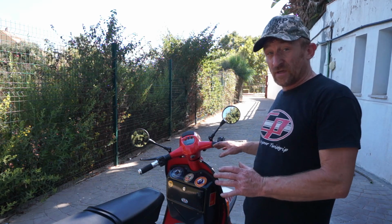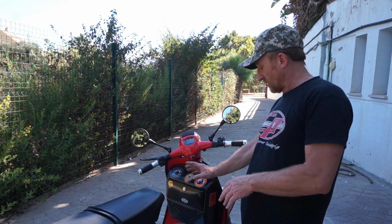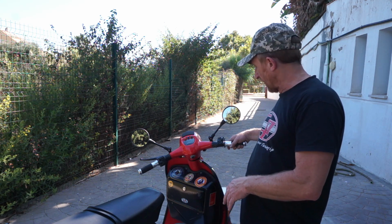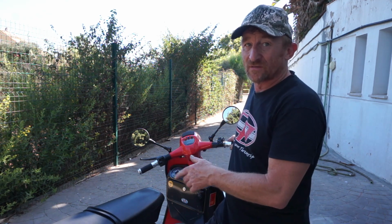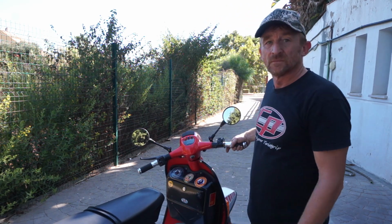So this bike's been running, it's already hot, so the procedure is to start this, petrol on, choke off, throttle about quarter and kick, and it should start. It's got a bellows on it, so there's always a chance of it flooding, but let's see. Sweet.